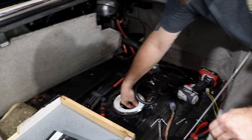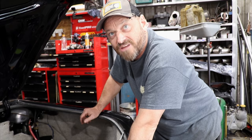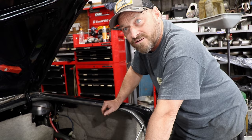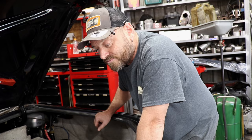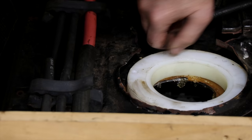So what are we going to do to rectify this problem, Alan? Well, we did some preliminaries on this when Mark still had the car down in Sydney. He's an old Datsun fiend from way back, so we figured it's probably got the same sort of sender unit as some other Datto from the 80s. He went and hunted around and found an HR-31 Skyline fuel sender unit which has the same bolt pattern as this. So we're going to use that, put a new pump in it, and hope that works. A fuel gauge would be handy.